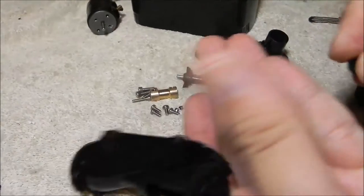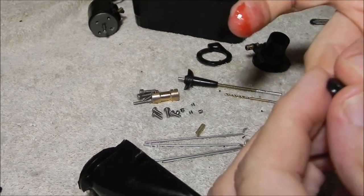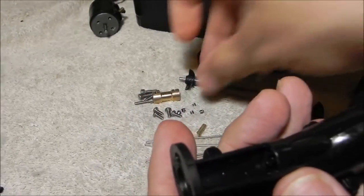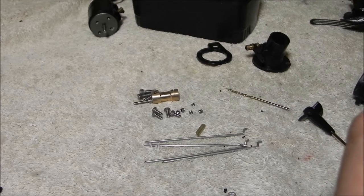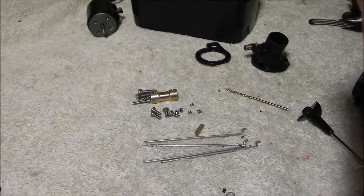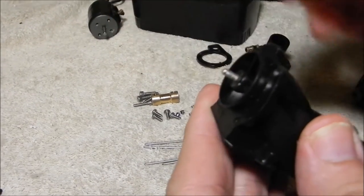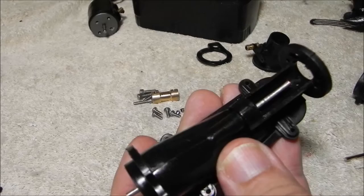Take your grease seal — we'll put a little bit of grease on the seal. This is just standard everyday grease you can buy at your hardware store, something you want to have anyway if you're doing RC boats. Put a little grease in there like that. You'll see when we put our flex cable in, it won't fit nicely — you may have to push it through that grease because the grease seal hole is a little bit smaller than our shaft. Push it back in there. That's about where we want it — we want to come up just a little bit further, right in that area.